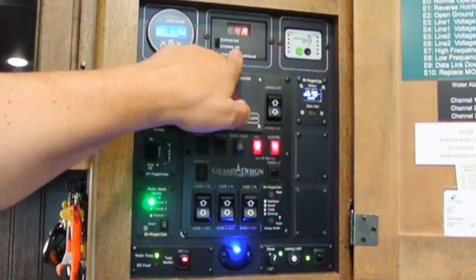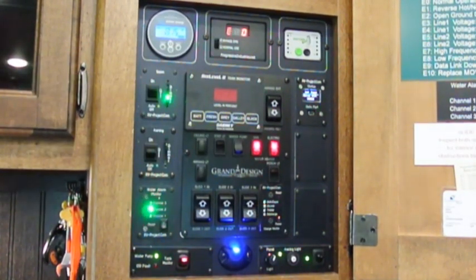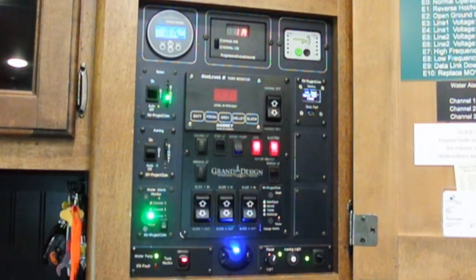In the top center, this is a hardwired Progressive Industries electrical management system, and this is a 50 amp version. I highly recommend every RV have one. It monitors the voltage, and if the voltage goes low, which is going to be probably one of the most common issues with electrical power in a park, it'll disconnect the RV automatically so you don't damage any of your appliances or your air conditioner and those kind of things. So it actually saves the equipment in your RV. And then when it sees the voltage go back to normal, it will also turn it back on again.